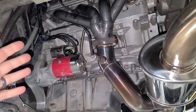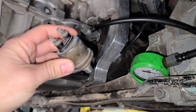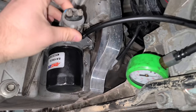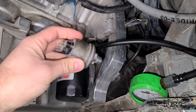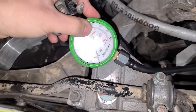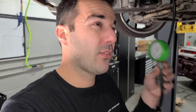First we need to verify that our LS1 doesn't have a bottom end issue. This is the factory Porsche oil pressure sensor — a two pin sensor running into the factory harness, using an adapter to screw into the LS engine. It reads in bar, so my thinking is there may be a translation issue between what it's reading and the gauge in the car. We're going to eliminate that by testing with a mechanical oil pressure gauge. Normally at cold start we're at two bar on the gauge, which is 30 psi.